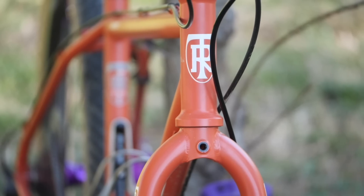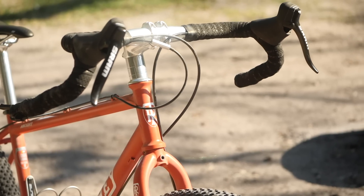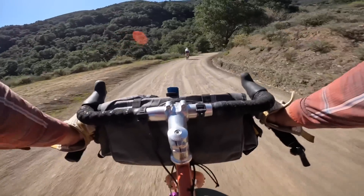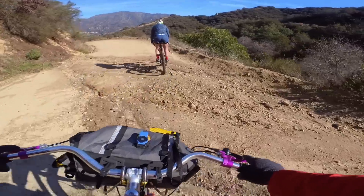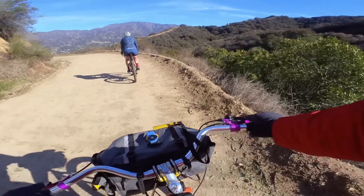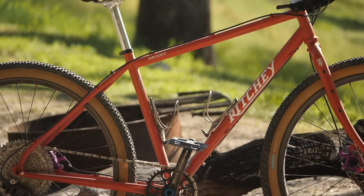It's also rocking that inch-and-an-eighth non-tapered head tube, which is a bit of a rarity these days. The idea is that because it's not so built up, there is some natural compliance — rather than the modern backwards way of having a super stiff head tube and trying to soften up with shocks, the Ritchey approach is to build that compliance into the frame itself. The frame has a sloping top tube, making it a perfect candidate for a dropper post or a suspension seatpost. It is rocking boost spacing, so you've got to use a modern mountain bike wheelset and crank.